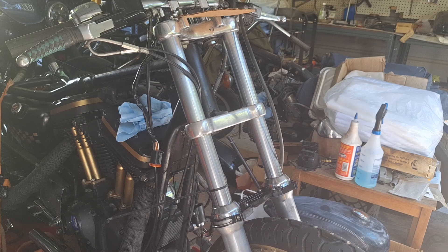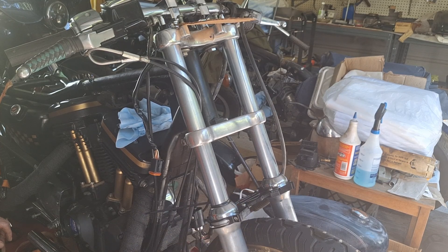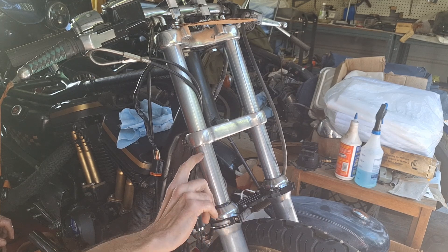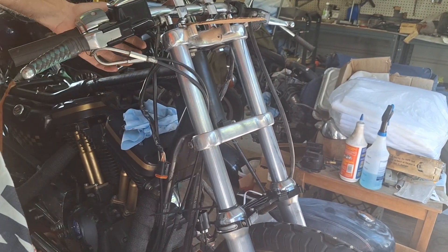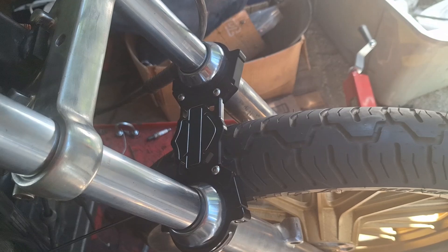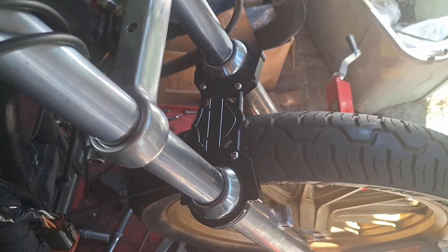Anyway, that's it for the sag on the front end. What I do is leave the wire tie on here so I can see if it's bottoming out — I can pull the front end down and measure it to see what my bottom-out travel is. Hope that helps somebody out. Fairly simple process — so easy a monkey can do it. Hope everybody has a good week. That's our spring sag. I've got other videos where I replace the fork seals, fork tubes, and fork braces. Still working on the front fender. Everybody have a great week — thanks for watching, take care, I'll see you next time.